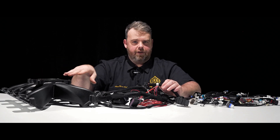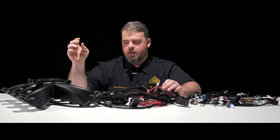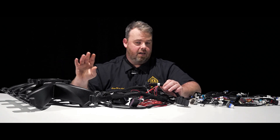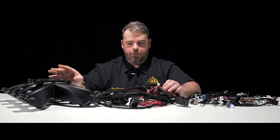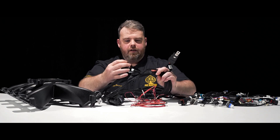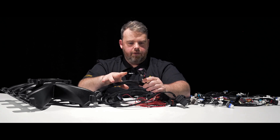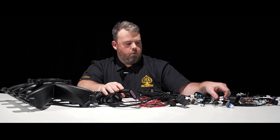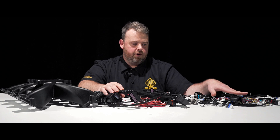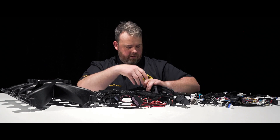It's fantastic — there's no extra fuel rails or anything else. You've got your normal 43.5 PSI or 58 PSI depending on which system you're using, and it's got a nice classic look. I like the gold throttle body, though I more prefer the pink one — but the black one's pretty cool too. We get to the additional wiring harness, which is where our loose-lead harness is going. There are also some add-ons in here — they're just wires, but we are adding more features, so we left them in there for you as a convenience.